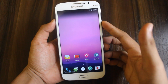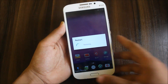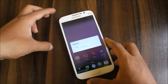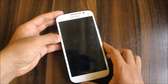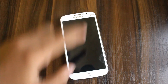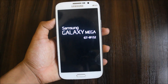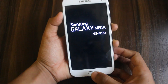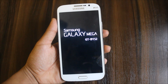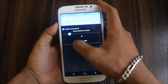Our first step is to boot into recovery mode, so go here and restart into recovery. Now this will boot into recovery mode. My volume button down is not working — not on this ROM, it's overall not working on any ROM. It shows the safe mode symbol. If you don't have the soft reboot version, just power off your device, press volume up, home, and power button at the same time to reboot into recovery. This is the i9152 dual SIM variant of the Galaxy Mega.